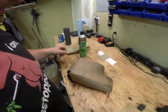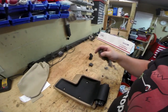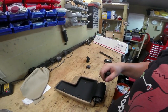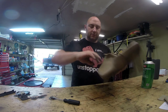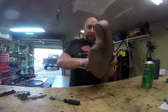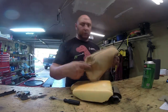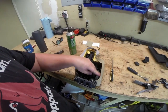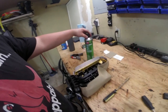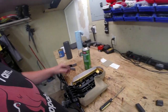Alright, we've got our center console armrest. The color is not a 100% match but then again the interior is all different types of faded. First we remove the back panel — three Phillips head screws — then we strip it down. You can see this stuff is just glued in, so the first step is to remove the old cover, which just peels right off. Then you want to glue all the inside pieces down using spray adhesive like 3M Super 77, and clamp it down.